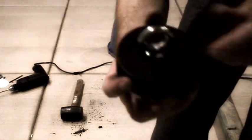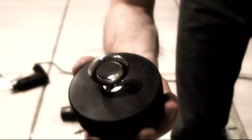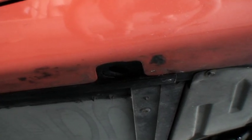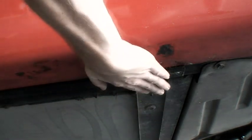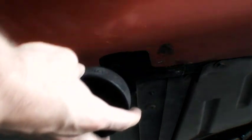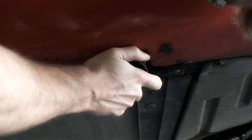Make yourself a jack puck, a heavy duty jack puck for lifting your car without scratching your car. Now, if you take a quick look, there's not enough room there to place a lift at the shop. So what they typically end up doing is swinging that lift around, putting it right on the rocker panel and lifting up, which destroys it. So that's what these guys are for.